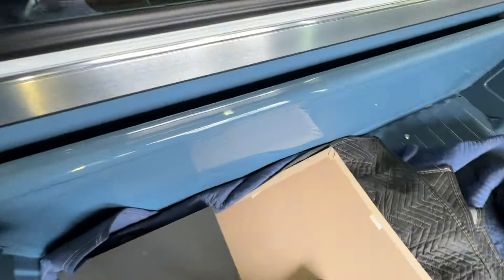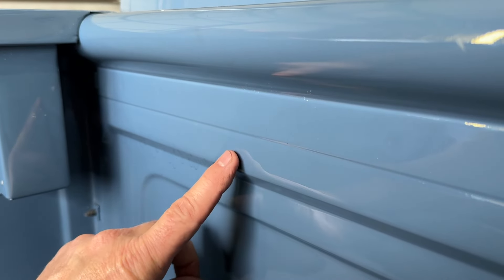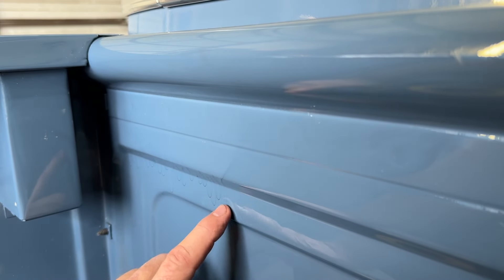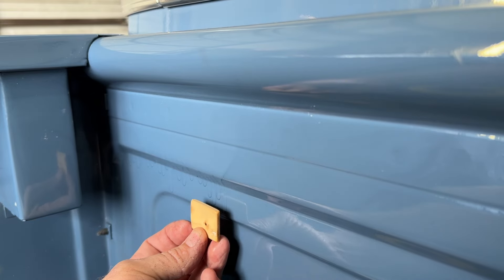I really don't want to climb in this bed, but I'm going to put down some blankets — something to distribute the weight. This paint is single stage. The thing about single stage is when it drips like that, it changes the color. So even though we sand this out and polish it, it's probably still going to be visible. You'll see a little bit of color change — it's a little bit lighter. You'll see these dark areas. All that is probably still going to be there when we get it flat because it's single stage.